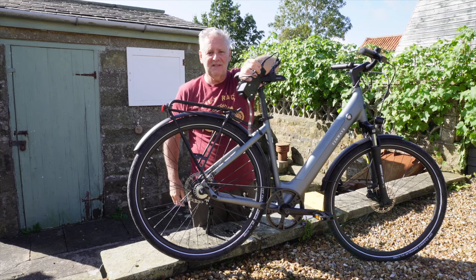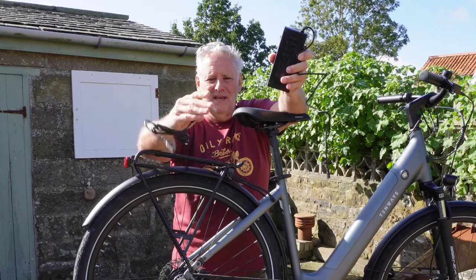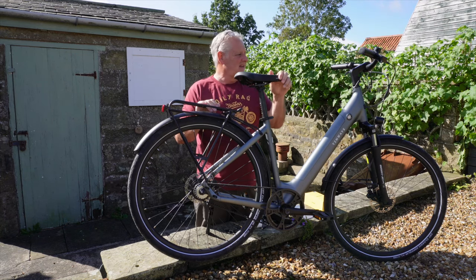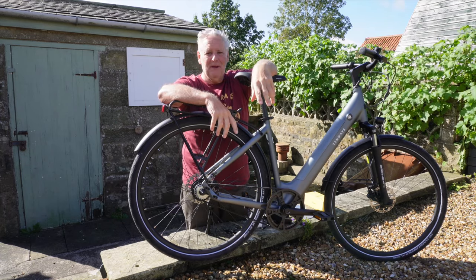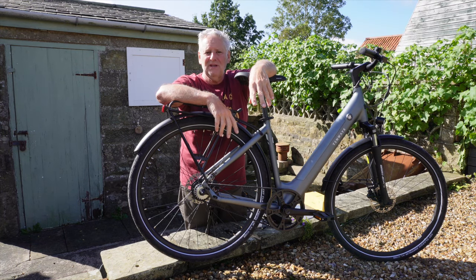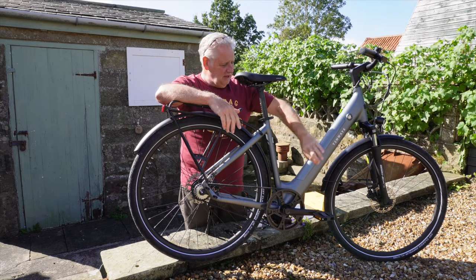Our experience with charging: it took about four and a half to five hours to charge from almost flat. This came with a European plug on it but it's only a figure of eight plug, so you can buy a standard UK plug to go on it - but it did come with a UK adapter. The range on this is supposed to be 100 kilometres, and usually what they do on those ratings is a very small person on the flat using little power in a nice warm country. Well in Yorkshire with me and Jo riding it, we've probably got about 35-37 miles to a full battery, and we've probably had that on high power most of the time as well. So the range is good for a bike of this size with a small, thin battery like that.